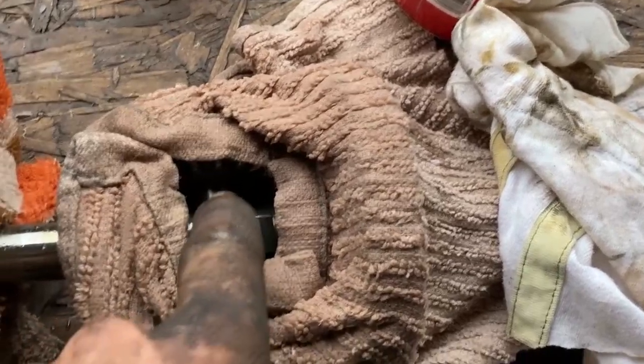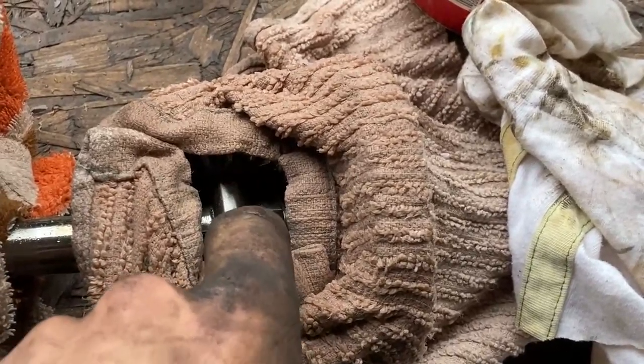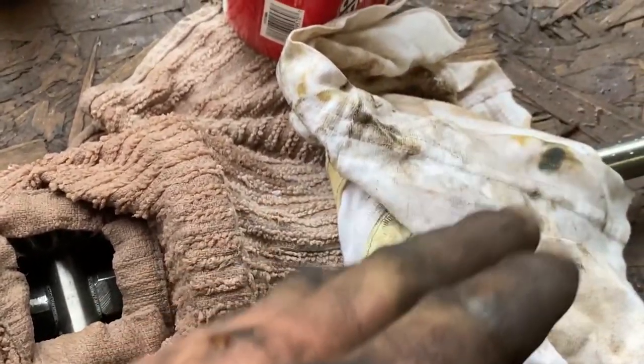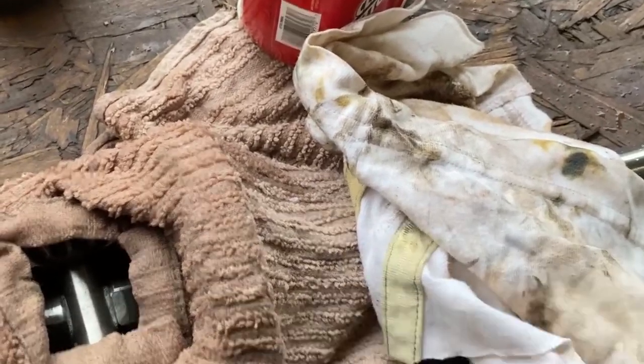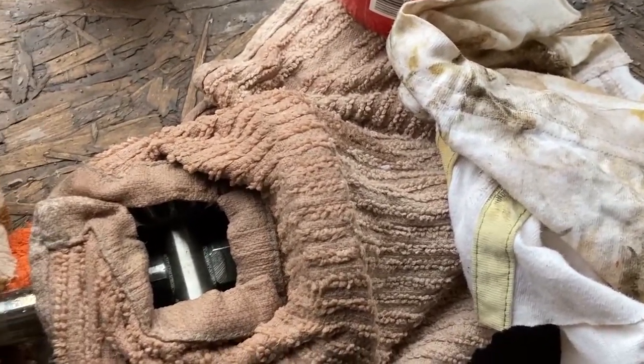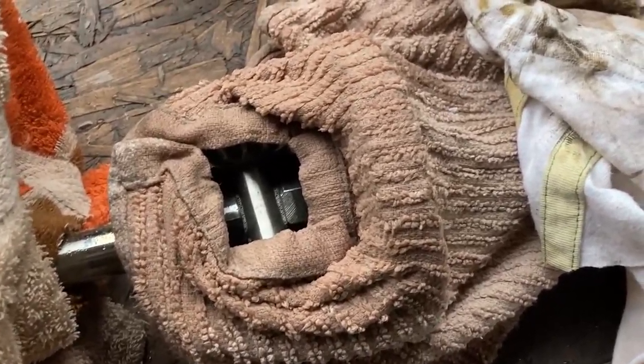So you're better off welding these gears to the center shaft. That way the axles still have a little bit of movement to them, so they're not stuck rigid. And it's quite likely your locking job is going to last longer this way. There it is tacked.